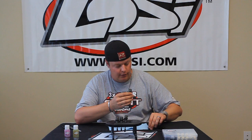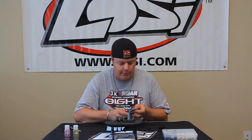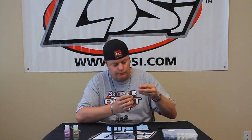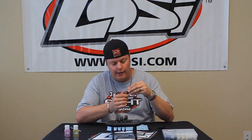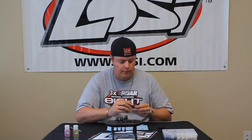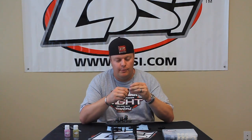Take and set the bladder on top, bleeding out any excess oil. Wipe it off on a paper towel. Drop the foam compensator on top, and then just screw the cap on. Now you can compress the shock a couple times and you'll see the shaft come back out about halfway.